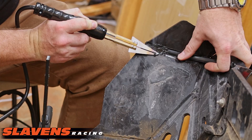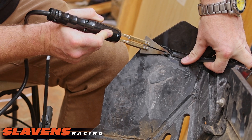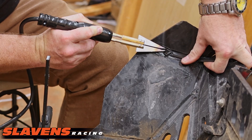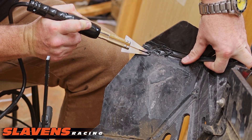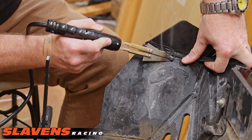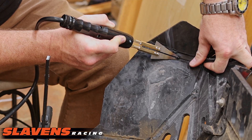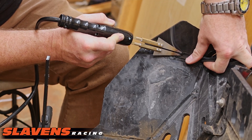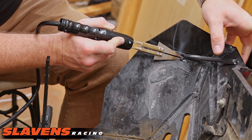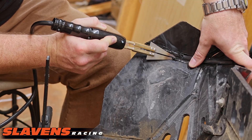So it's just one of those trade-offs, and these plastic welders are about 100 bucks. We want to make sure that once we get it spread out a little bit it's actually melting the two pieces together — we want that to be like one fused piece. We don't want to just heat up one side then heat up the other side. This isn't like normal welding penetration where we've got a quarter inch or thicker piece of aluminum fusing all the way through; this is pretty minimal, so we're going to put some staples in here too and hope that will keep us in place.